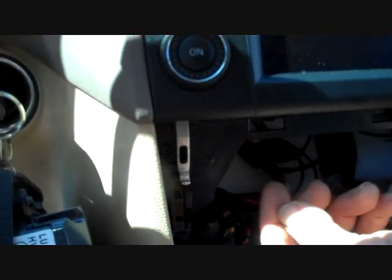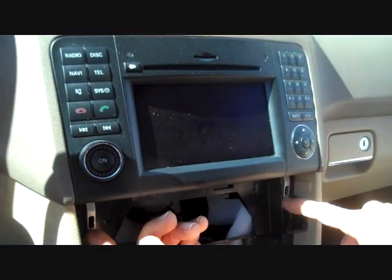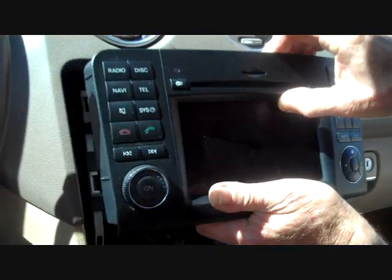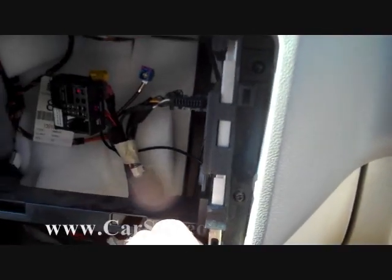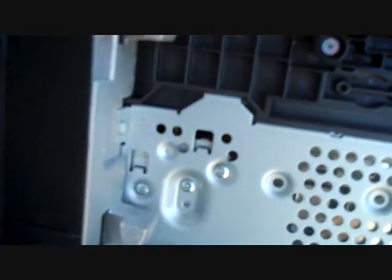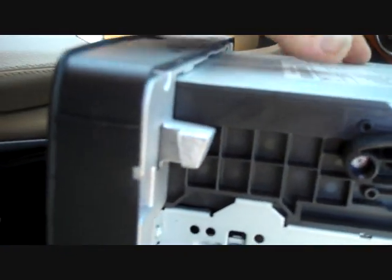There are several tabs on each side of the car stereo that these metal pieces lock into, that lock it into the dash. With these down they release and you should be able to pull the car stereo right out of the dash. This metal bar — as it pushes up it locks in, and down it has little openings. One opening here and one opening on the top, and these openings allow the tabs on the sides of the radio to go in. When the bar pushes up it pulls it into the dash and locks it into place.